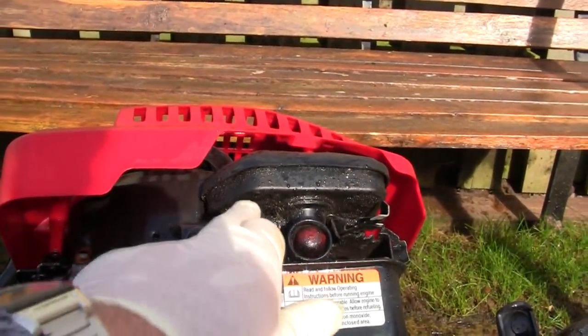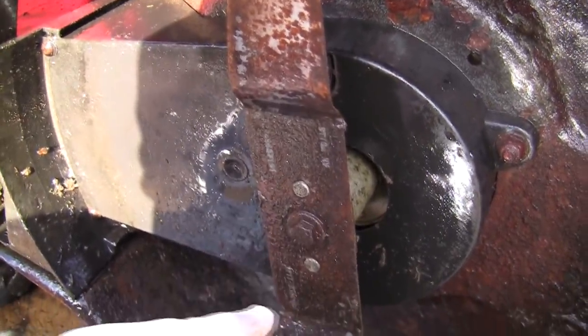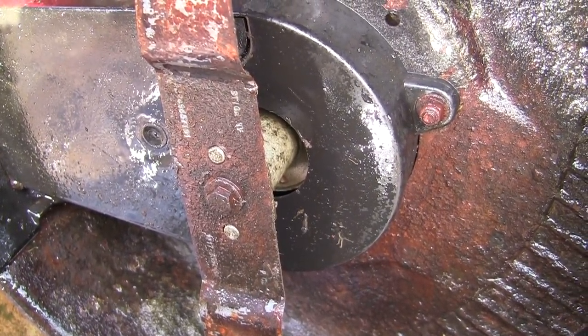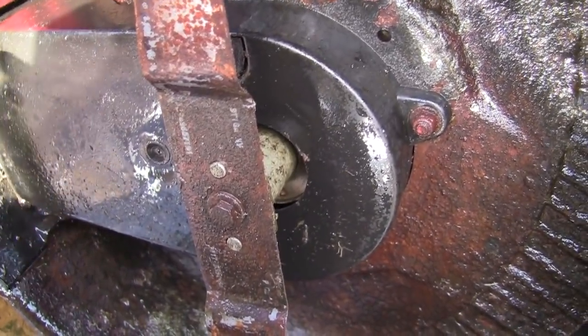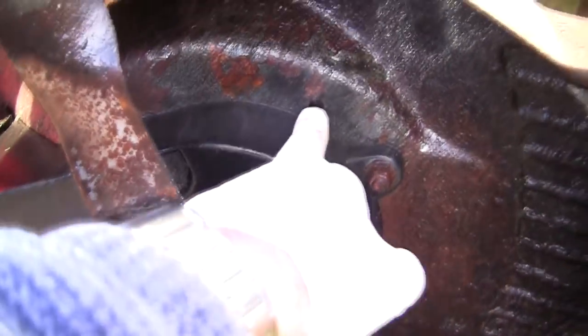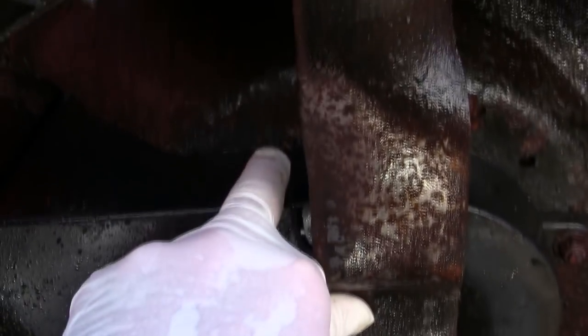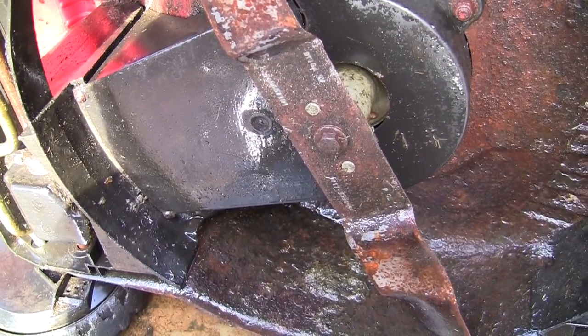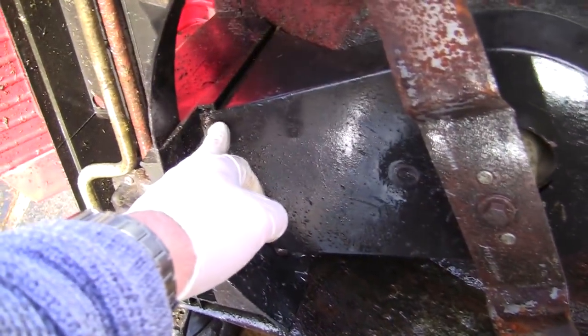One thing you should know is which way to tip these mowers. They say to tip them back, but it's not practical to work underneath them unless you've got a bench. If you're just trying this for the first time in your garden, always tip them with the carburettor side up, the air filter side up, and the exhaust facing down. With all the fluid out, the next job is to remove the blade. If you've got some basic spanners you should be able to get it off. I've got an impact tool I've reinvested profits into which makes it easier. I also want to take off this belt guard cover and clean all the grass out from underneath.